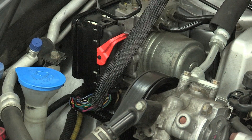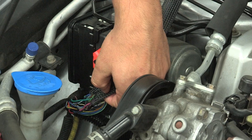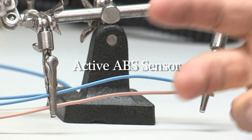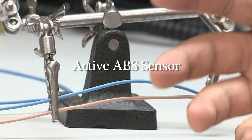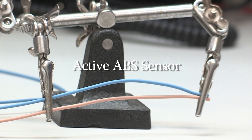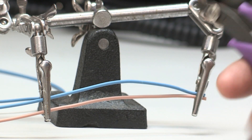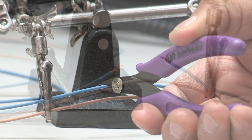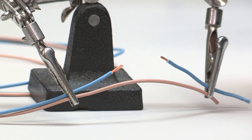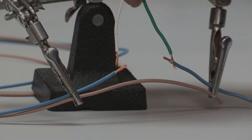In the TSX, you can see the traction control wires being tapped and soldered into the ABS control unit. First, I'll be showing you how to install if you have an active ABS speed sensor. Let's pretend the blue and brown wires are from a wheel speed sensor on your car. You will need to cut the negative wire — let's use the blue as an example — and using the correct pair of traction control ABS wire inputs, you will need to solder one on each end.